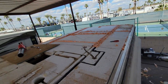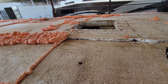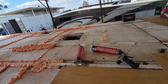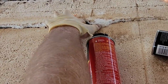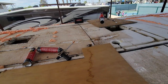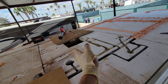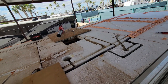I've pretty much foamed up most of the roof. It's just deformed so much that I'm going to have to almost treat it like bodywork and fill that area — that way when I sand it, it'll at least be somewhat flush. This area can't be brought down and that really can't be brought up; it's just the deformation of the foam itself. I do want to add a brace right there and on both sides of that opening, because that's where the AC is and that's where the whole thing collapsed.